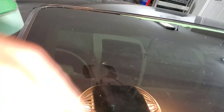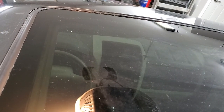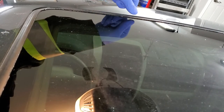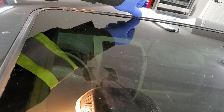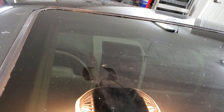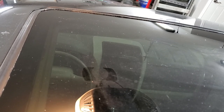This is the first time I'm dealing with this issue, so hopefully I'm doing it the right way. Another thing to mention — I kind of forgot about it — sometimes on the edge of the cab there is a rusty spot that's not flat, and water can get in. So open your roof, inspect it, and if there is any rust, clean it, sand it, prime it, and paint it. Now let me do the leak test.